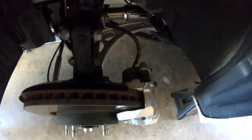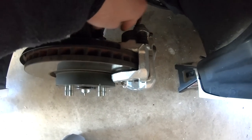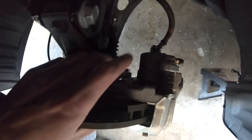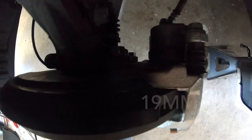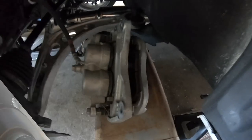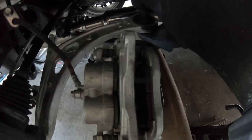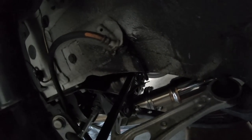Getting started. First thing on the OEM WRX brakes - two bolts back here. These ones are 17mm, but the STI ones are going to be 19mm. Knock those two out first, loosen up the caliper, and we're going to take off the rotor. I'm just going to leave the WRX caliper there for a second. I've got PB Blaster soaking on the brake line right now for the flare nut - it's a good idea.